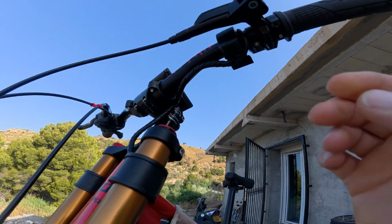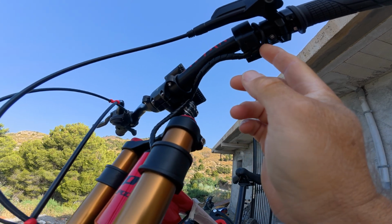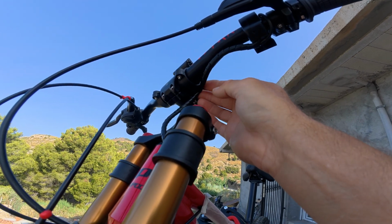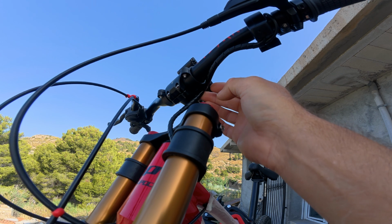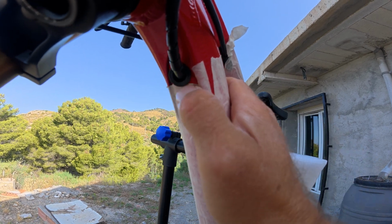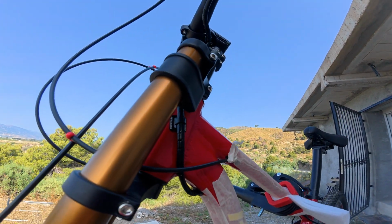I've actually used some wrap-round conduit around here. I'll show you that in a bit more detail in a minute. To join this wire together, it's the thumb throttle and the controller, the two wires back together, back to the controller. Then the controller wire's gone off to the controller, and I've joined the controller wire and the thumb throttle down to here, round, down into here, made all the connections and pushed it back through the hole, and then put the grommet in place. So that's all looking fairly tidy.